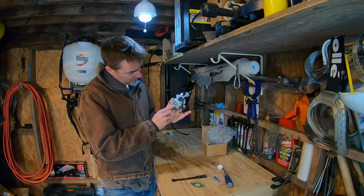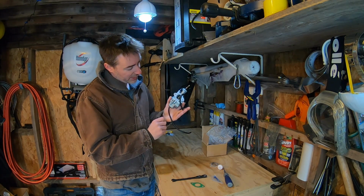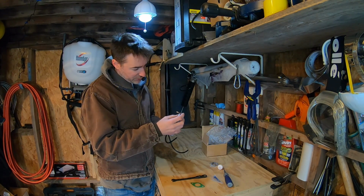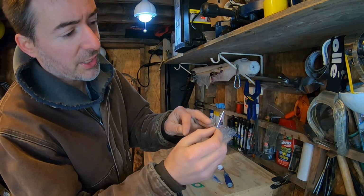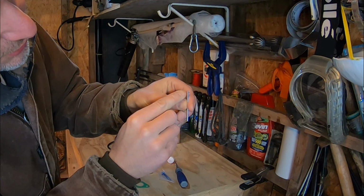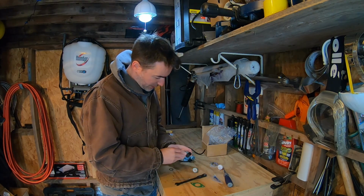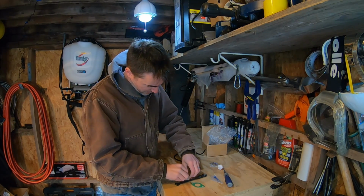So on the fuel side, not sure if it's going to mean anything, but from the factory, that looks like that fuel air screw is way down. Let's take a look at the factory setting for the needle and find out if this needle is even adjustable on this unit. So, knockoff Chinese Mikuni style carb, you can't adjust the needle level. There's only one place for your E-clip, so you can't richen or lean out with the needle. I just dropped a little washer out of here. So there's going to be no adjustment there.